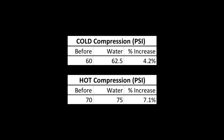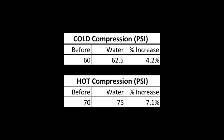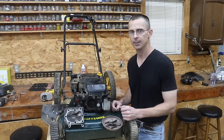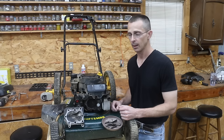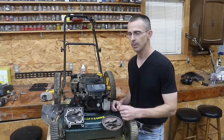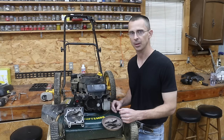On one hand, the cylinder head and the combustion chamber looks a lot cleaner. On the other hand, we ended up with water inside the engine. I spent two hours running the water through the engine at a very consistent pace. I tried to follow directions — many of you provided really good suggestions on making sure that I didn't dump too much water in at once, so it was a very slow trickle the entire time. I actually had to add fuel to the lawnmower to keep it going. Did you notice the exhaust temperatures as well as the cylinder head temperature was way down as water was being added to the combustion chamber?